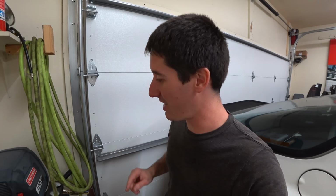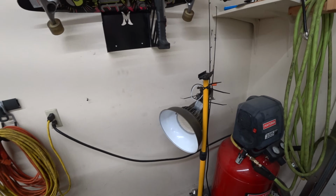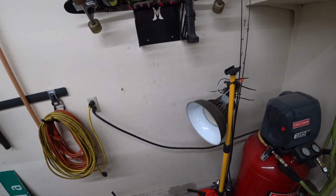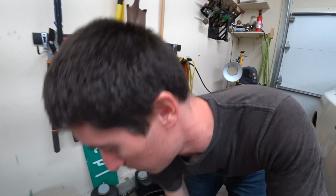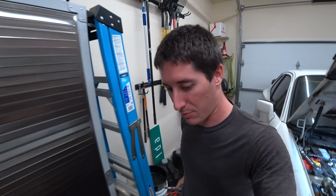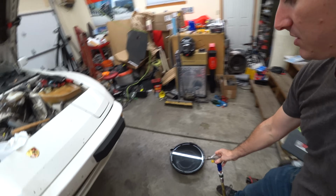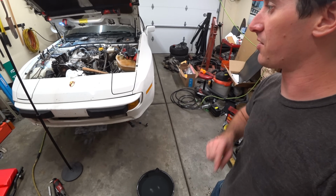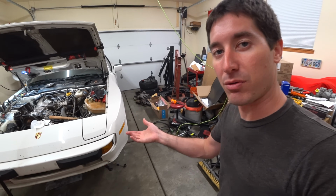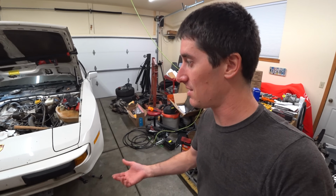So over here, I went ahead and set the air compressor to 10 PSI on the regulator. Let's spool out a little bit of hose, and we're gonna take this over to my bucket of water, which is just an oil pan that we filled to the top with water. Here we go, and we'll set it in here. I'm going to plug one hole and put that blowgun in the other hole, and I'll just cover one with my thumb. We'll put 10 PSI on that thing, and if it leaks, it's trash.